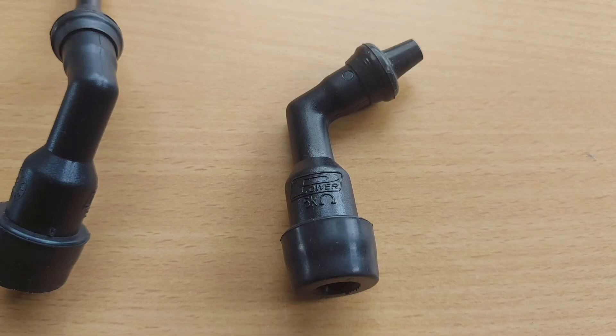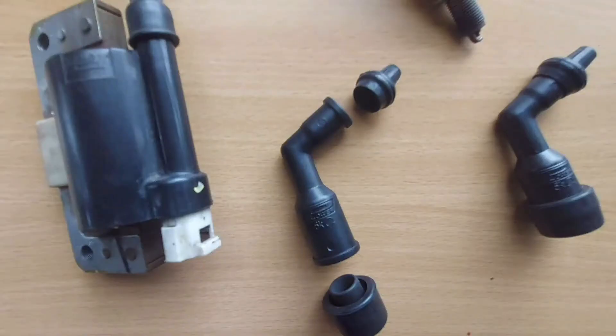The ceramic resistors are usually of 1, 5, and 10 kilo ohms. The resistance values are mentioned on the outer shell. On both ends of the plug caps, there are rubber liners which prevent moisture coming into contact with the electrical lines, causing electrical leakage.